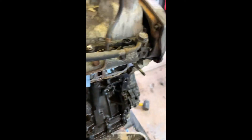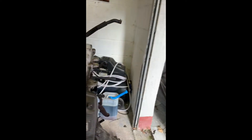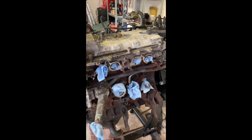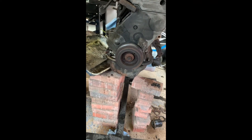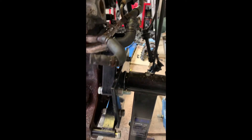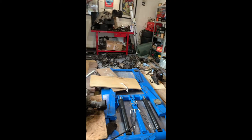It looks like the problem is from the camshaft — this is where it's been leaking, just here. And in there too, though it's quite difficult to see; this is the original leak that caused me to pull the engine out. Everything's mucky over time so it'll all get sanded, primed, painted, and fitted with new gaskets. The bricks are here as a backup because the old iron block is so heavy — I wedged them in to take the weight off the engine crane harness, which was slowly bending.